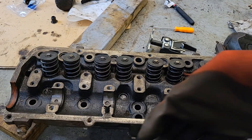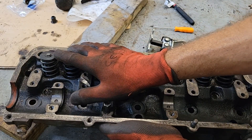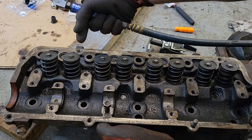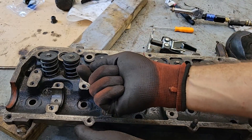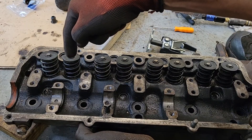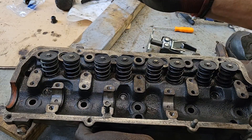Do the whole thing and you should be leak-free. You don't have to take the head off the car. If you do it with the head still on the block, you need a tool: pull the spark plug out and thread in an adapter so you can put your air nozzle in where the spark plug was, and pressurize the combustion chamber. The air forces the valve into the closed position, so when you pull the keepers out and pull the spring off, you don't want that valve to just drop down into the combustion chamber — if you do drop it, you're pulling the head off to get it out.